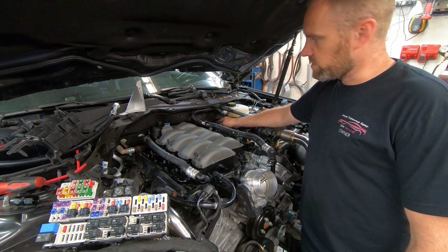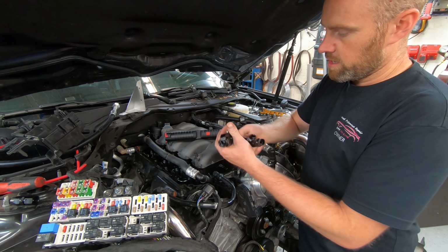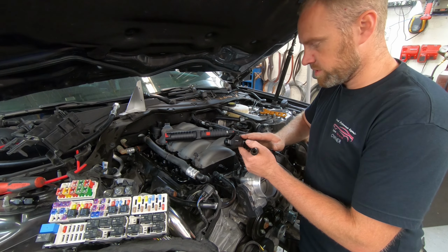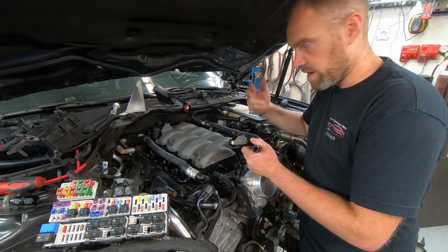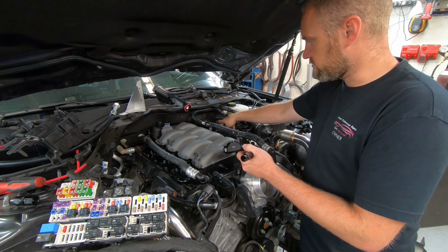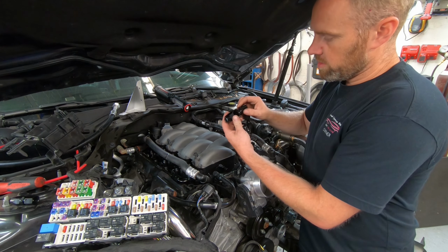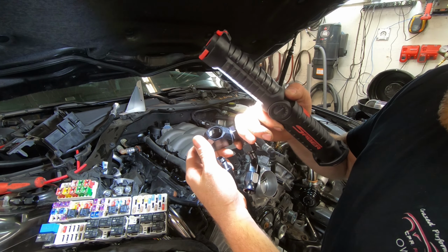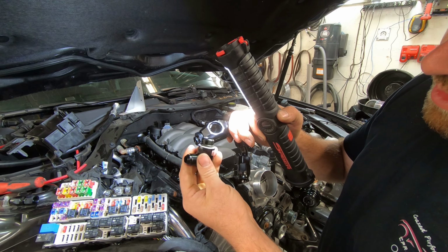So what I'm going to do is I'm going to run the pumps across here, and then this fitting I've chosen for flow reasons. The best thing I could do with this right now as it sits is to use this fitting as my union to split out, or my splitter, to split out the fuel from this fuel line to the rest of the system. So this splitter is extremely high flow. Now, it's a big, wide open hole in there, and this is probably a -10 actual fitting on this thing is what it looks like.